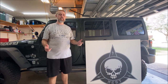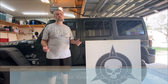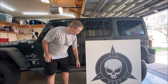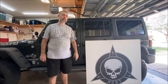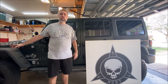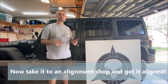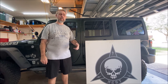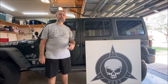Two and a half inch TeraFlex suspension lift with shocks and everything — pretty simple to install but it did take me a good 10 hours total, including time for the video, front and back. Really happy with the way it turned out. The rear end stayed about the same height but the front came up about seven eighths of an inch. Pinion angles: eight degrees in the back, two degrees in the front — and neither changed when I replaced the lift. If you have comments or questions drop them below, and the video description has torques, parts, and tools listed. Please like and subscribe if you found it useful — take care and see you next time.